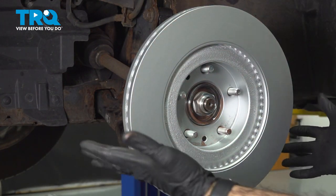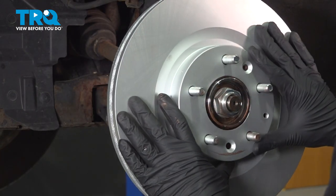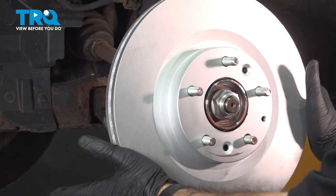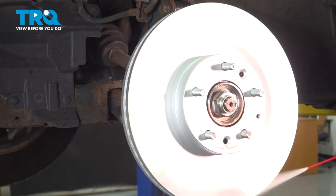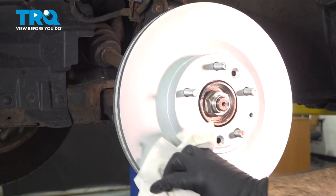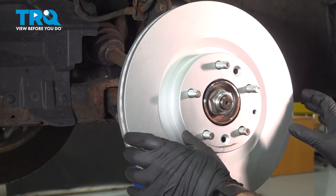Once you're done with that step, make sure your hands are clean. Take your rotor, flip it around, and line up your Phillips screw holes. At this point, I would suggest putting your two Phillips screws in — it's going to hold your rotor in place. Unfortunately, we don't have our screws, so we're going to work with it moving around a little. Once you have your two screws in, take some brake clean again and clean off the surface where your pads are going to meet. That rotor surface — you're going to want to keep it clean and free of any greases or oils. Your next step is going to be your brake caliper bracket.